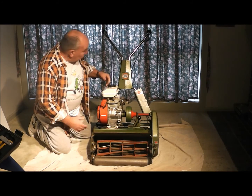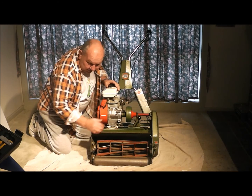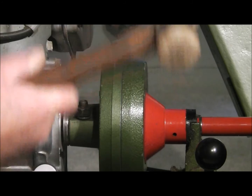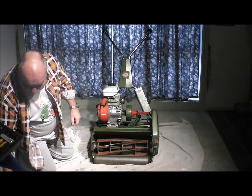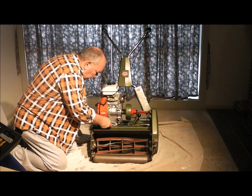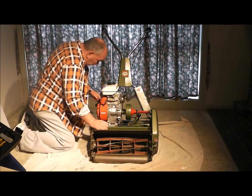So we're going to remove that initially and then undo the four bolts here. We're going to knock this captive cotter back into position, which hopefully will release it from the shaft using a hide-face hammer. So the first thing I'll do is crack these nuts — these are half-inch SAE.